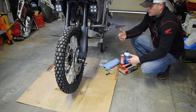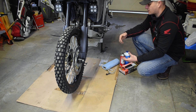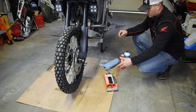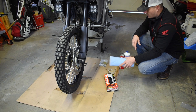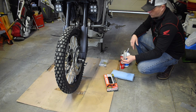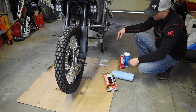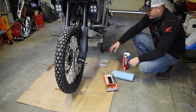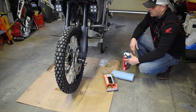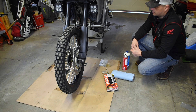Next we're going to be working on the brake lines, and one of the most important things with any project is staying organized and keeping things clean. When you're messing with brake lines it can get messy, so things nice to have are rubber gloves, paper towels. For bleeding the brakes, a length of hose is always great because you can direct where the brake fluid goes as you bleed them. You'll need some DOT 4 brake fluid, brake cleaner, and some kind of catch pan for your fluid. Maybe even putting cardboard down is wise.